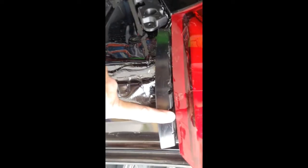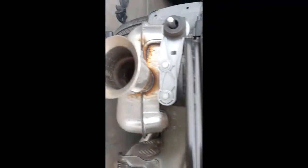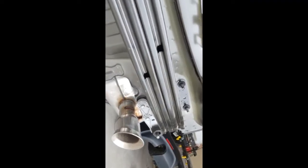The bumper actually pulled off pretty easy. There's one more last tab here before you can pull off the bumper — you can see the tabs for the side. Now we need to remove this bar; it will actually be discarded. Our hitch will then mount to those same bolts — four bolts there. And you'll need to take a tie-down and hook it to your spring underneath and then to the next spring, so you can support your exhaust so it doesn't fall down too much.